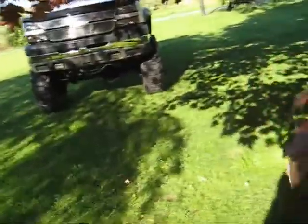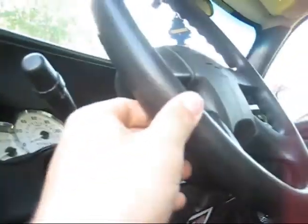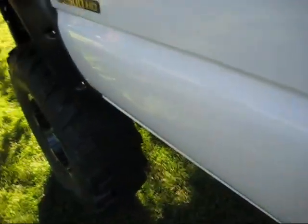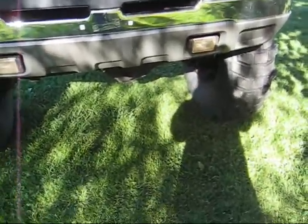This thing just recently had some quirks. I just had a new track bar joint put on, because my other one was squeaking. When I picked the truck up, the front end started shimmying — my steering wheel was doing one of these going down the road, and it never did that before. I called the guys back and they said check your tires. I said, how could it be the tires if it wasn't doing it on the way down? Well, everything was tight, I re-tightened everything, greased the kingpins and the steering and all the other fun stuff. I did just rotate my tires and that helped.